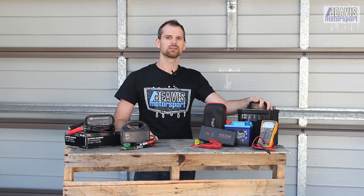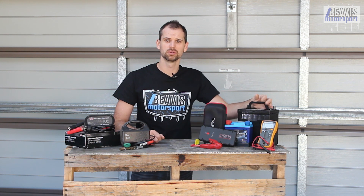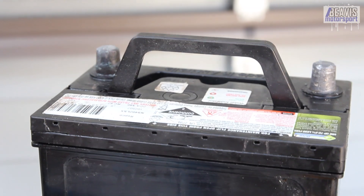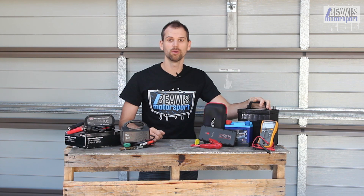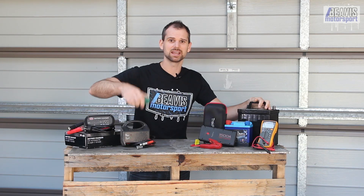Secondly, cutting power when storing your car. The key is to avoid letting the battery voltage get too low while the car is sitting. One of the easiest ways to do this is by disconnecting the car's electrical systems. Even when the car is shut off and parked, it still slowly saps some power. While you could simply disconnect a battery terminal, I like to use a kill switch like this, or these green knob-type switches — really handy tools.